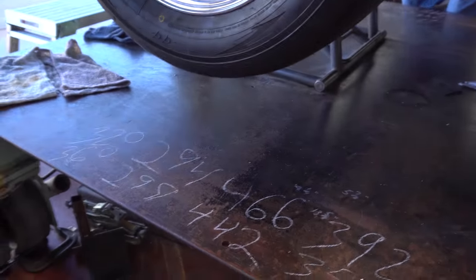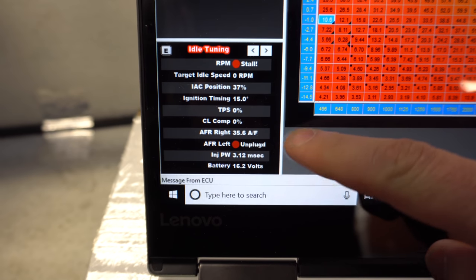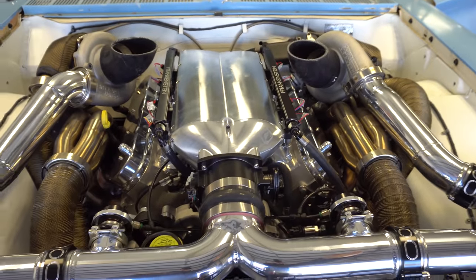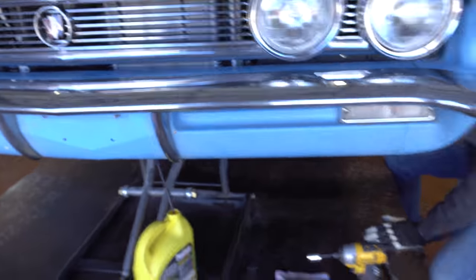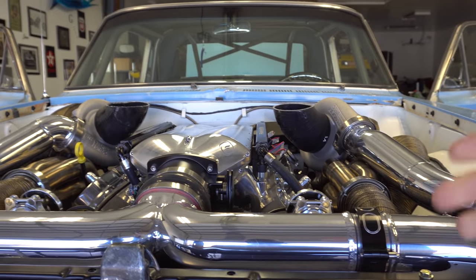We're just trying to decide if this cylinder looks pretty lean, figuring out where we need to chase to find why it's so rich or so lean in what area. As you guys can see, AFR right is 11.0, AFR left is 13.4, 13.1. We've been verifying what side's what, and the left is actually the left when you look at it from the engine bay. This would be the left O2 and this is the right O2. So we're actually seeing a bunch of rich condition on this side, which is kind of mixed with the 466-degree cylinder. So maybe it's getting a bunch of extra fuel in the pipe and lighting it off there. So we're going to see if we can figure out what's causing this bank to be so rich.